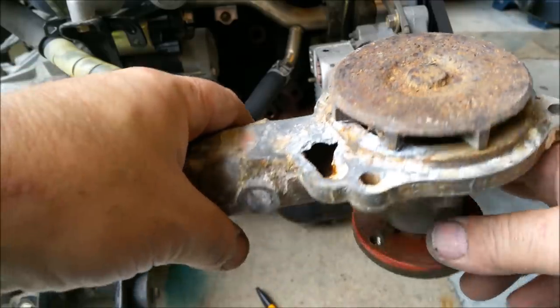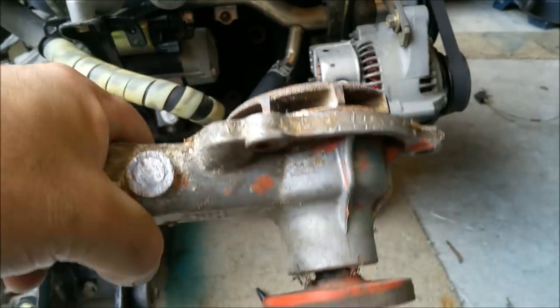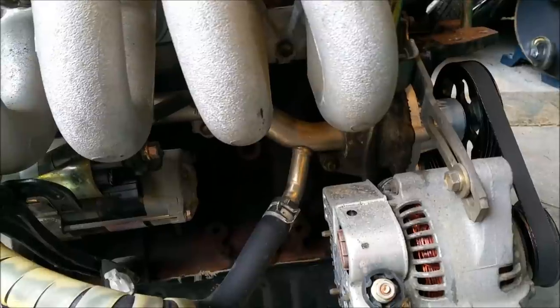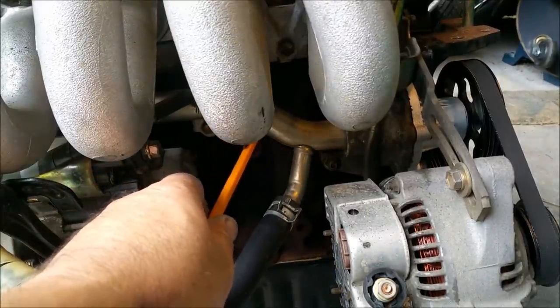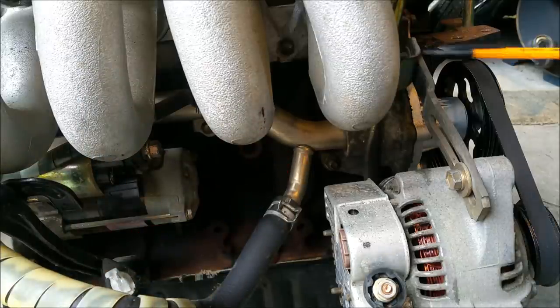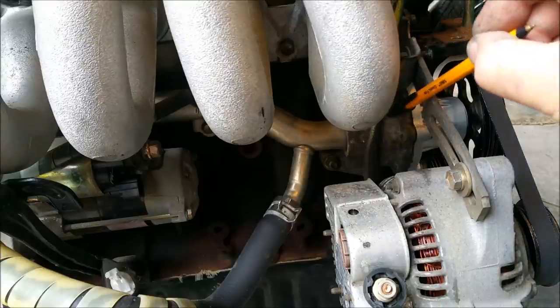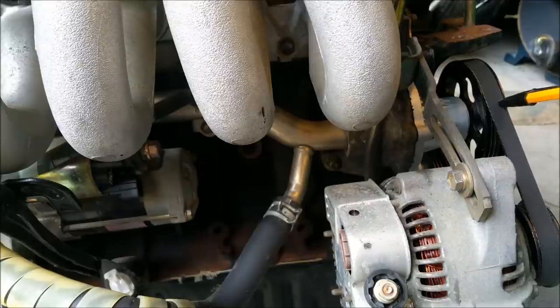Now, a good example of centrifugal action is when you wash your clothes or other articles in a washing machine. You open the lid when you're finished and all the clothes are stuck to the outside of the tub, and that is happening because of centrifugal force. So in the case of this pump, we've got a tube which is full of the cooled water from the radiator, and we'll talk about that in a moment, and it's thrust out sideways into the engine here via that housing.